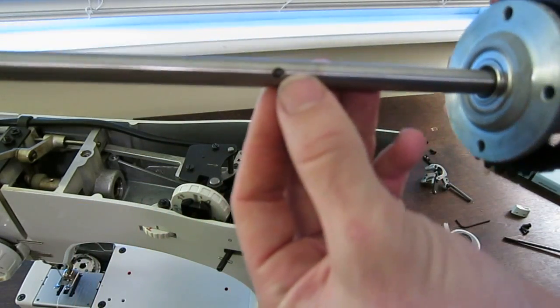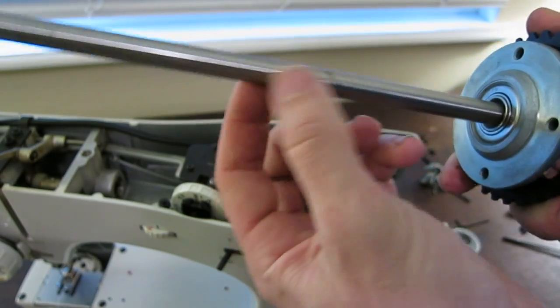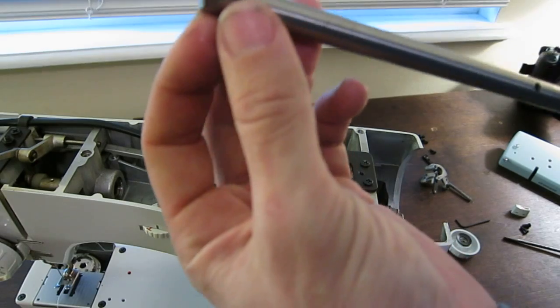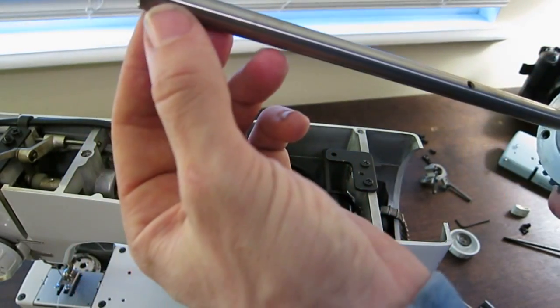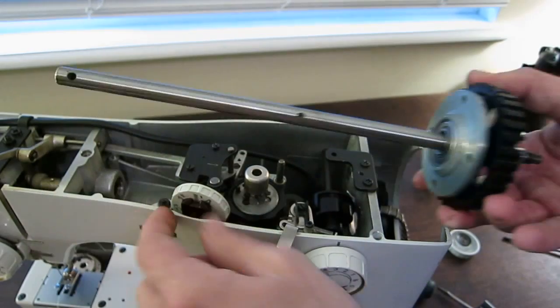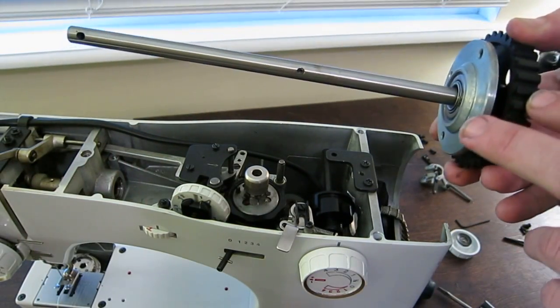Now you can see you still have your set screw in there. That's where that worm gear, or that spiral gear there goes. And then you can see for timing the end here, there's only 1 screw or 1 opening, and it can only go in one way. So you'll know that that will preserve your timing as long as your hash marks here and everything are right.